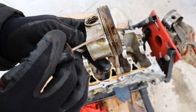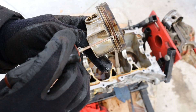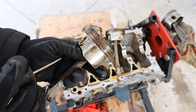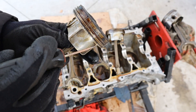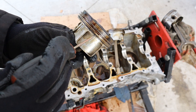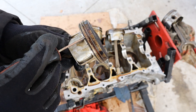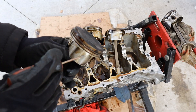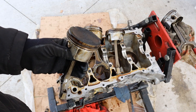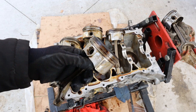So here's my rant. Here's the piston — we've got our two compression rings on the top like a normal piston, however take a look at that oil control ring. You can see it's like almost a one-piece design, so small and tiny compared to a normal one. Where's the oil supposed to flow? The reason they did this — they switched over to 0W20 and 0W16 weight oil, so you have a lot of thinner oil and theoretically less friction. In reality, it does not flow through that ring. The thing is basically clogging it up. When this piston is sliding down, most of that oil is just going to come back into the piston at the top and get burned out through the exhaust. Bad, bad design — lots of oil burning, and that's why this engine has a lot of oil burning problems.